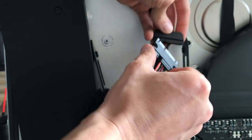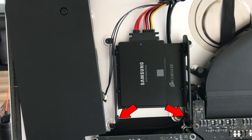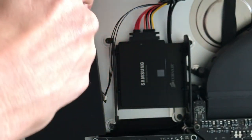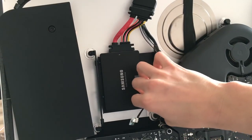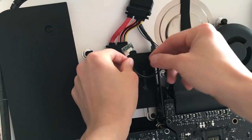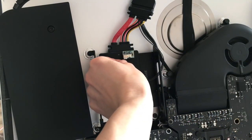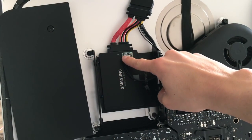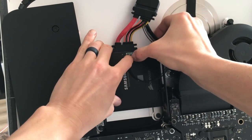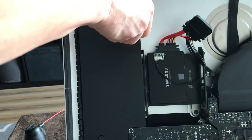Because this is technically the wrong bracket, it doesn't extend far enough down and the bottom torque screws don't quite reach all the way. It fits at the top though, so I just kept wiring and hooking everything up. From my research on installing the thermal sensor, they suggested placing it right where the SATA and power connector go into the hard drive. Peel off the adhesive on the bottom and firmly press it onto the drive. That's how you install the thermal sensor — it regulates your fan speed to cool the system if it gets hot. Then reassemble everything, starting with the speaker.